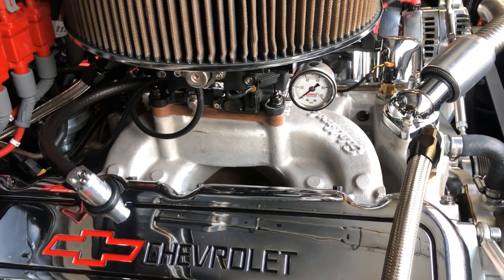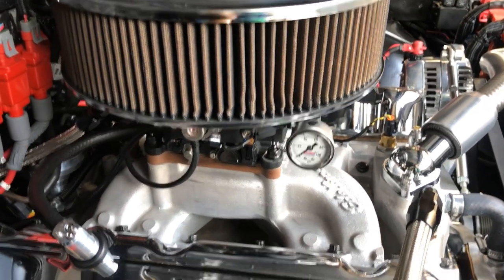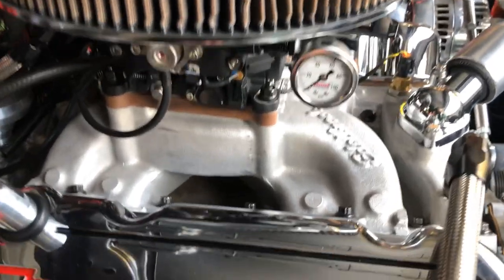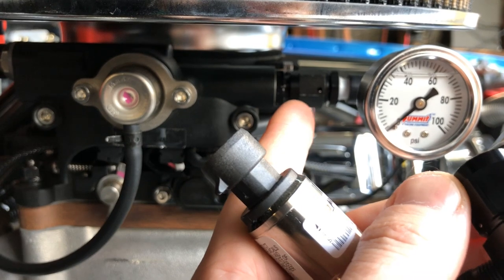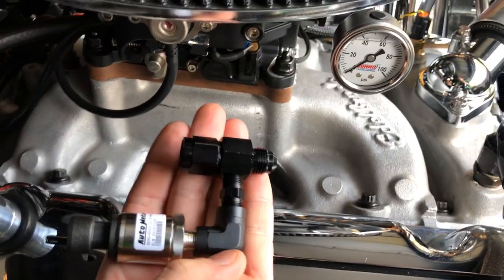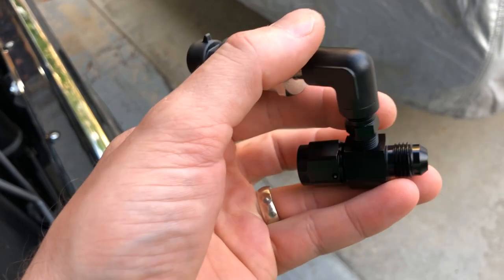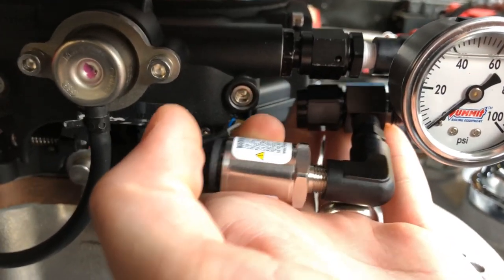The first thing I'm looking at here is installing the pressure transducer on the throttle body. I originally was going to put it on the opposite side where the fuel filter is, but it's a little tight back there. I think I can make this look nice fitting it in here. I've got this takeoff fitting I was talking about earlier - this is kind of mocked up by the way. This is the pressure transducer and an elbow and some fittings that I got. It's got a 1/8-inch NPT port right there. The pressure transducer is actually a little bigger than I thought, but it's not huge.